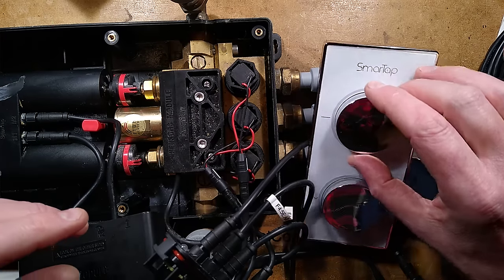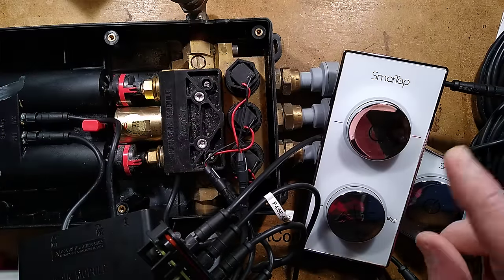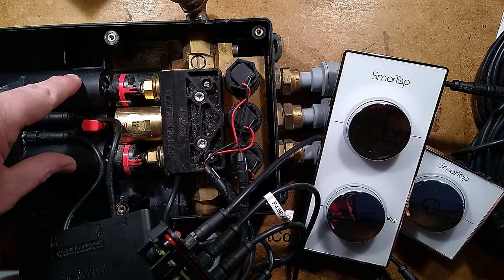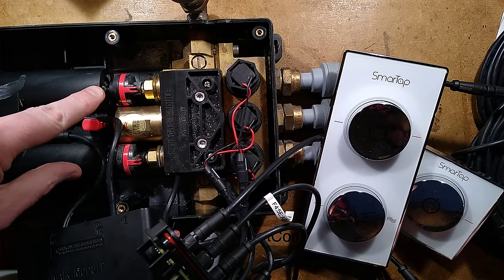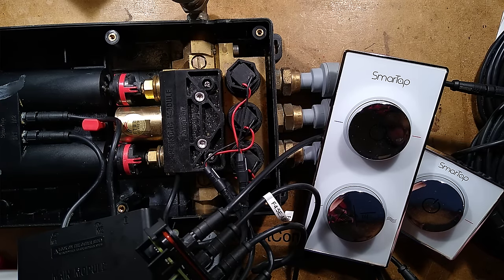The control is done with these two plates. I'll turn the power on to this and you'll see it goes through its initialization procedure. Since I got it, it's developed a quirk — it's not quite finding a position for one of these. So these are the two half-turn, probably ceramic taps, making lots of robotic noises. One arm just keeps making a loud grinding noise and the power goes up to about 6 watts, and it just never finds what it's looking for.